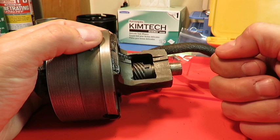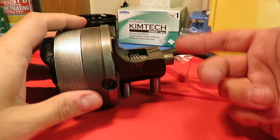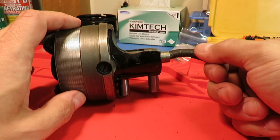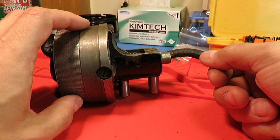So I'm not really sure what I'm going to do. I think one of the big comments that's made often is what the melting point is, because as this motor is working and heats up, the idea is that those felt wicks on springs are contacting this shaft in here, and the heat of the motor is going to then somewhat liquefy the grease that's in here and cause that to lubricate when necessary, with the wicking of the felt, etc. And I think that the melting point that you need to melt a blob of the grease versus a very thin film of the grease that's wicked up through very tiny capillaries within the felt may be different.